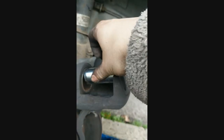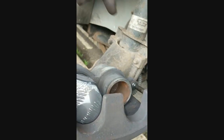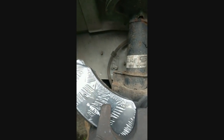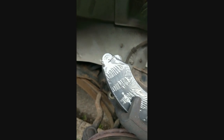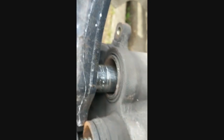What you have to be careful of is when you wind this one back in, this other piston will pop back out. So what I usually do is use something like a socket - pop that in the way as a blockade so that can't be pushed back out anymore while I'm winding this one back in. So I've got my G-clamp again. There's the piston blocked up, the other one, and then I'm going to get my G-clamp, pop it over the edge, and wind it up until it meets the bottom. We're going to wind this piston back in flat like the other one. Where we've put this blockade in, that's going to stop that other piston coming back out, because if you don't block it that piston will come back out.